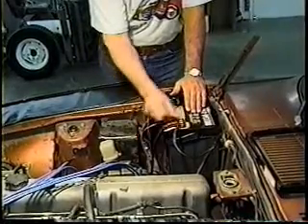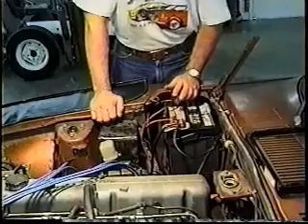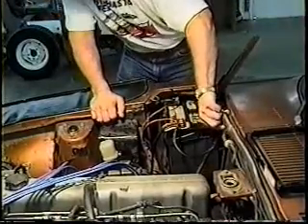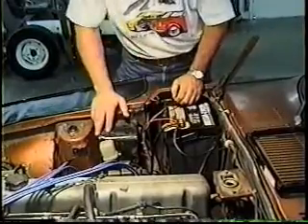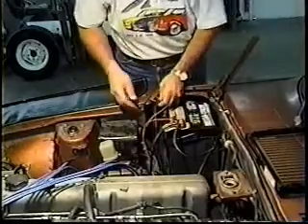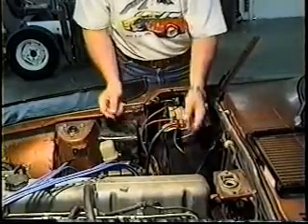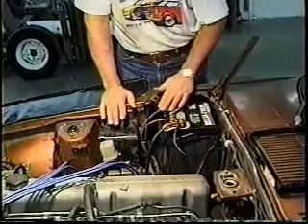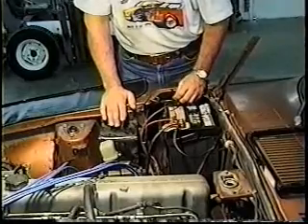If your cables look like they've got growth on them, cut them off and reattach them — clean the cables up on both ends. Nissan was remiss in one area: they didn't put enough grounds between the battery directly to the chassis. Originally they had a ground on the cable attached right here to this bolt. But you'll notice this one has an extra one on it. This wire is designed to do one thing — keep good communication between the battery and the chassis. The power being pushed into the chassis and returning to the battery is far less than the power going into the starter and alternator. Both big cables should go to the same place. The wires on the fuel injection and starter are basically 10 gauge size, so you don't need the return side bigger than those leaving — but you do at least have to have them. We call them sacrificial grounds and we like to add them anywhere we can.